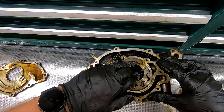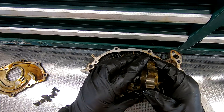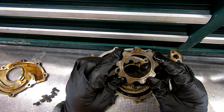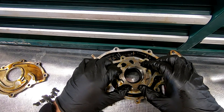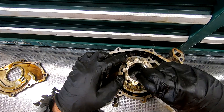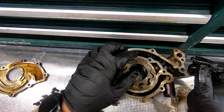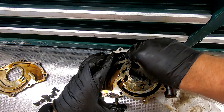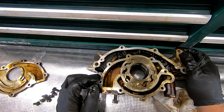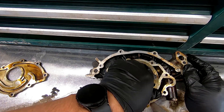You can see how the gear works by squeezing stuff up. We can pull the main gear out — it's got a flat spot and it runs off the crank, so this is how that works. It centers up top, and when she rotates, she squeezes. See how this passage has opened up? That creates your pressure. Oil is coming in here, sucking up, coming in through this channel, gets squeezed, and pushed out the other side.